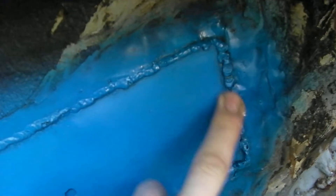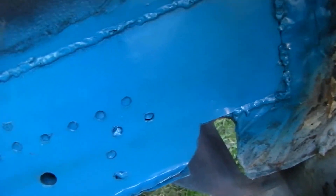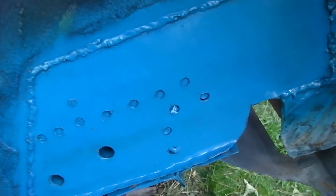I've seamed it round — still got to do it because that's where I ran out of gas. Grind it off, then I've got the reinforcement to go on. I've still got to clean that up, then I've got to repair it obviously where all the holes were, then get that welded back on and get all this undersealed.